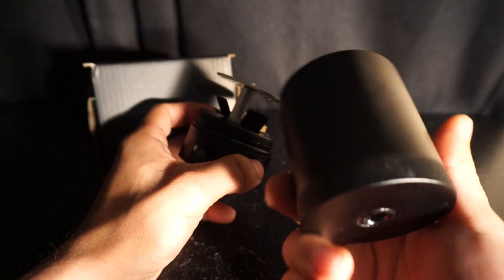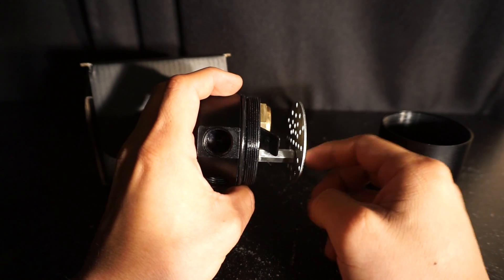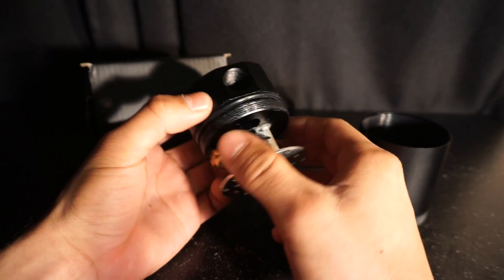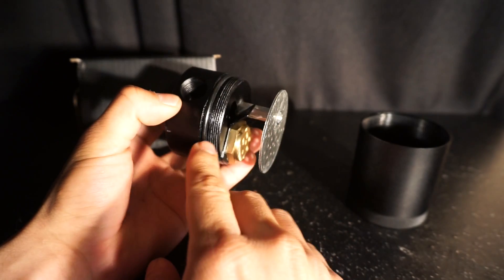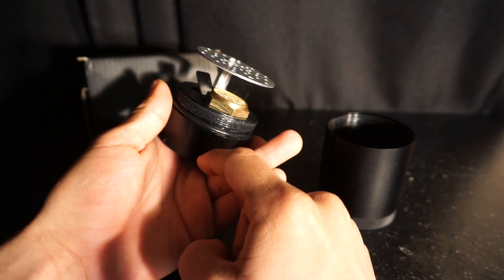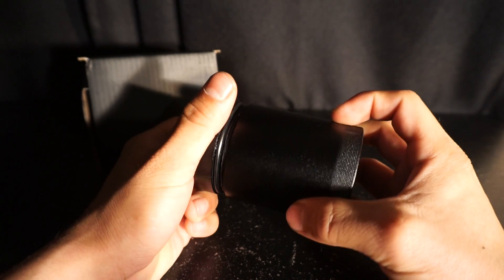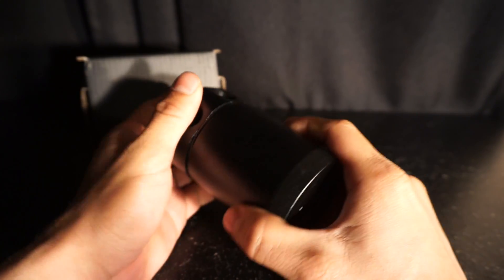This can holds up to 12 or 24 fluid ounces of oil. It's got an internal baffle right here to keep the oil inside, and then a bronze filter to help separate the air from oil — making sure that nothing but fresh air is going back into your motor. You have two inlets and one outlet. The two inlet ports are going to be dumping oil into the catch can, while the one port in the middle feeds your motor fresh air and keeps the oil inside. Oil vapors tend to increase knock and detonation, so in an ideal world you want nothing but fresh air going into your motor.